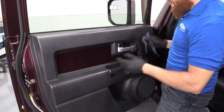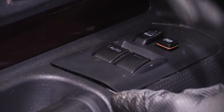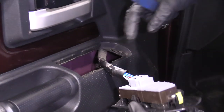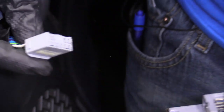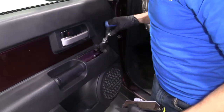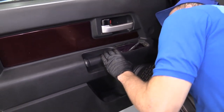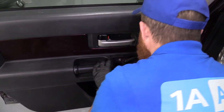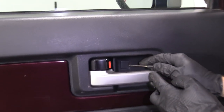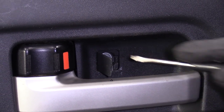One of the first things we're going to do now that the door's open — we're going to get behind this right here. Take something small like a pocket screwdriver, or whatever you have that you can wedge in there, and then pry this up. Behind here there's a little push clip. Always take a look at your wiring and make sure there's no funny colors. That one looks good. Right here there's a little cover — looks like there's a Phillips head screw, so let's remove that.